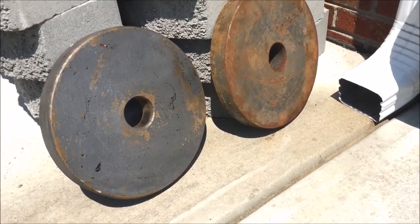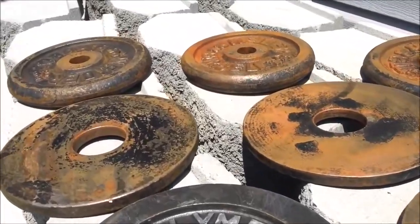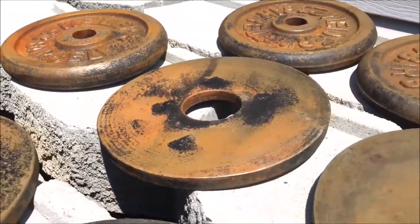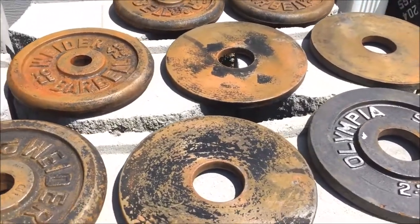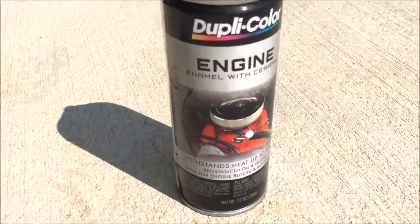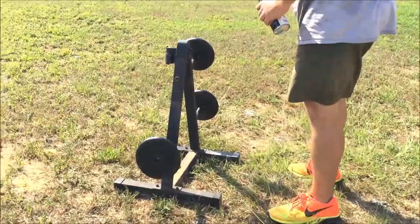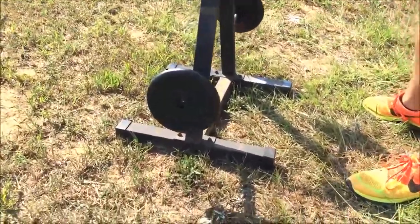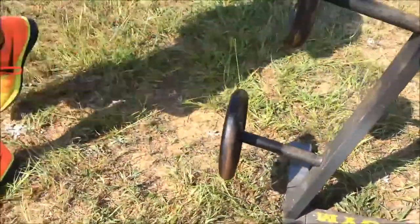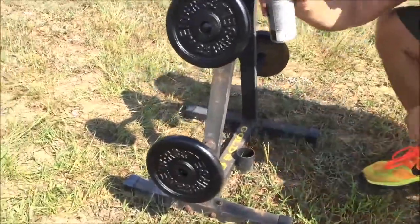Here you'll see all of the metal plates that I had in that bin out to dry. Notice how they flash rusted — that's okay. Before you paint them, just knock them down with some sandpaper or a sanding block to get that surface rust off. They were bare metal once I scraped the paint off and the atmosphere just hit them and they rusted in a matter of like three seconds. So I did prime these first, but here you'll see I have some black engine enamel by Duplicolor. Really love this stuff — easy to handle, it's a semi-gloss black and goes well over primer. I'll include a link to that in the description as well as the cleaning products I was using earlier.